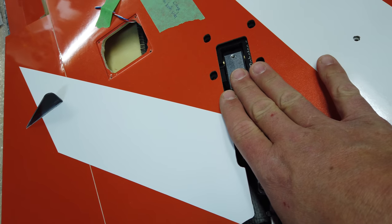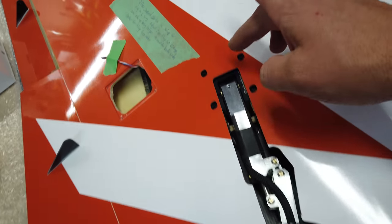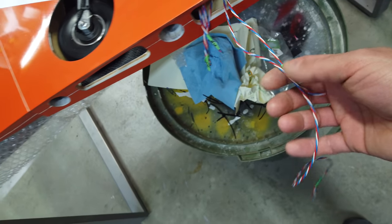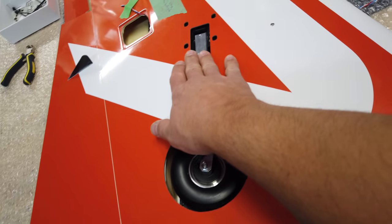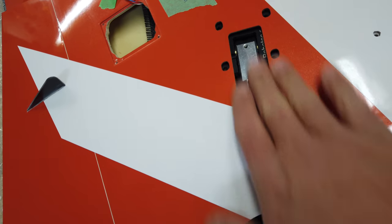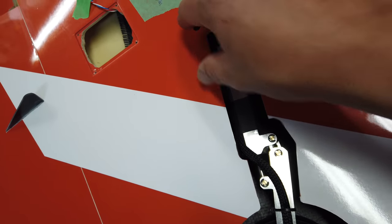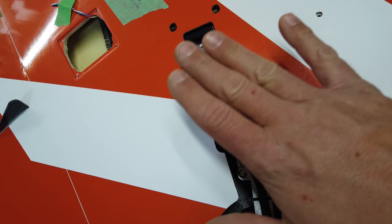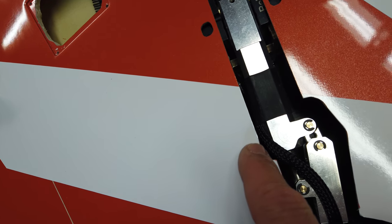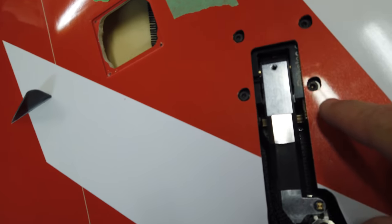The gear is installed but not bolted down yet. As I'm sliding the gear system in, I'm making sure I pull the cables to check there's no binding and they have a nice flow through — that worked out quite well. We've got a lot of excess cable; I'm going to keep it in there in case the gear needs to come out. Neither the gear nor the actual leg itself is bolted in, so I'm going to bolt the gear into the airframe and leave the leg loose.